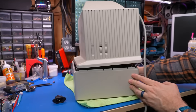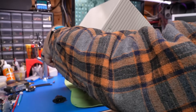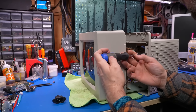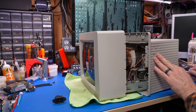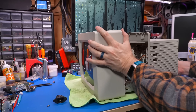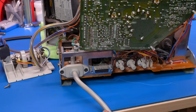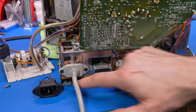To take the cover off the Apple IIGS monitor you have to take the controls off first before sliding it. You put the monitor down, pull it away a little bit, and there's one screw to remove — then the controls come free. If you just yank them away you could cause damage because the brightness and contrast controls go to the neck board. With that screw out it just comes free, and then we slide the cover off — feeding the cord through as mentioned. With the cover off, we can see the little plastic piece looks exactly like an IEC input jack.